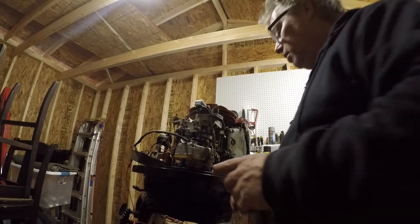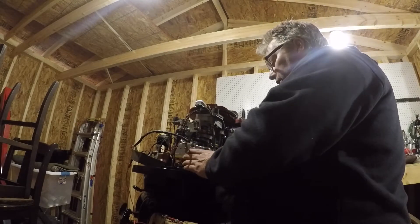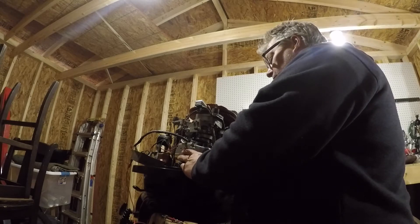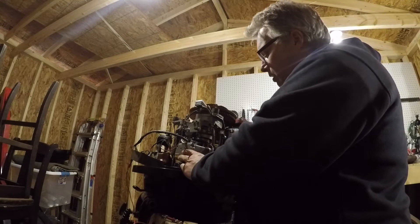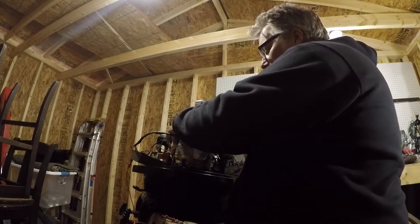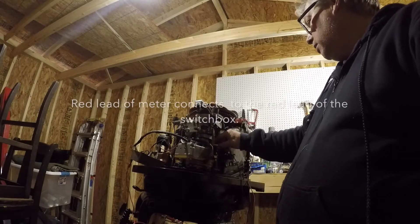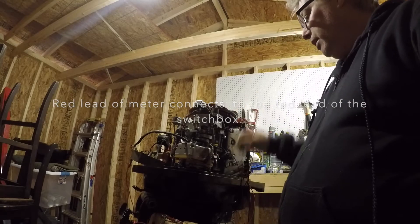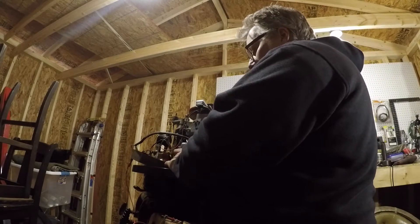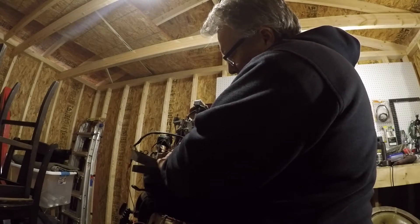The coil I put in here is the red coil — that's sort of the mystery coil. What I've learned is it acts like a magneto: at high speed the magnet inside the distributor makes its magnetic field to the red coil. I've got my negative lead from my meter to ground, my meter is on continuity, and so now at full wide open throttle you can hear it beeping.